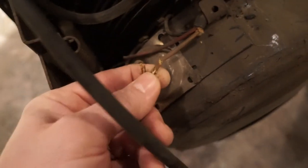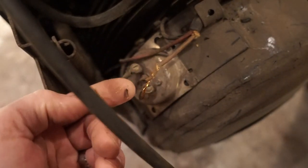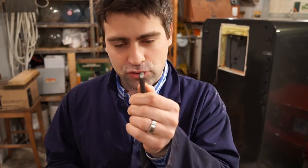So the wiring on the compressor down there has gotten pretty crusty and, I would say, very questionable and probably unsafe. So I went ahead and bought some new stuff, some 16 gauge wire. I bought some 3 wire so this way we can ground the fridge. It was never grounded, which is why the electrical plug, when you plug it in, only has 2 prongs. Well, we'll now have 3. We will ground it to the chassis of the fridge. Modern appliances, of course, are all done this way, but back in the 50s, they didn't really care about safety, apparently.